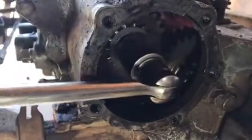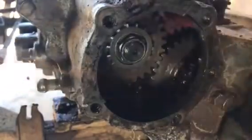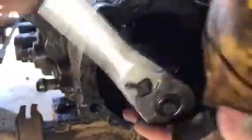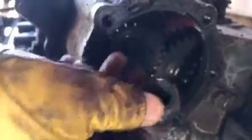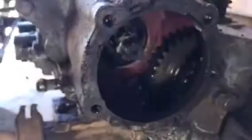This will keep the main shaft from spinning so I can use my breaker bar to undo the main shaft nut. After I've got the main shaft nut loose, I'll just use my socket and my ratchet to finish off removing it. The main shaft nut is part number 801367. Reaching inside the case, I'll wiggle out the main shaft gear, part number A989.